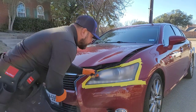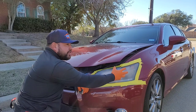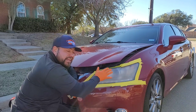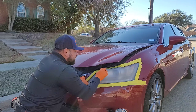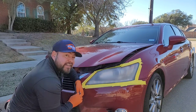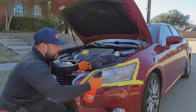Always as you're doing headlights, just be patient with it so it can air out. The headlight will start airing out and you'll start seeing the areas where maybe it needs a little bit more attention. This one is looking really, really good. What you want is just that nice flow of lines - you don't want your lines going everywhere. If you start in a circular motion, do it all through the headlight. Don't switch it up because once you start switching directions it creates a big problem. We are now using 800 grit.